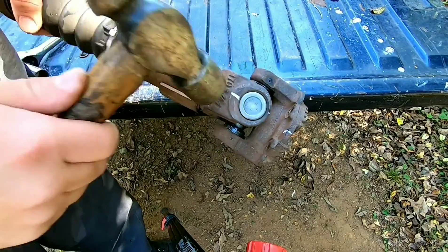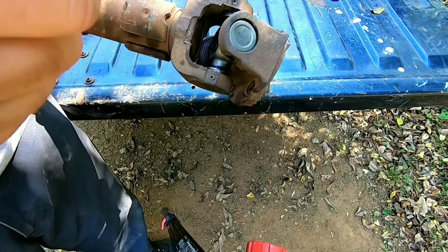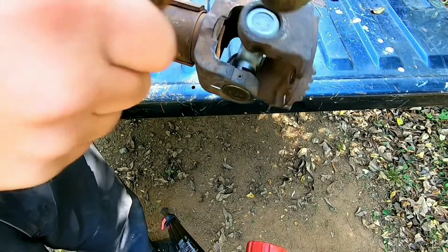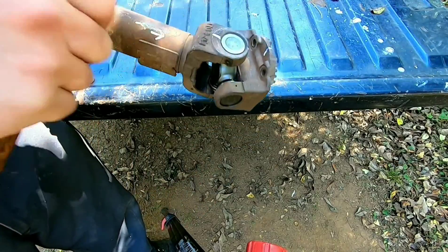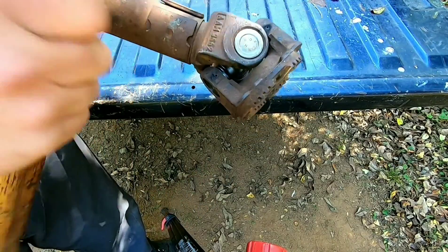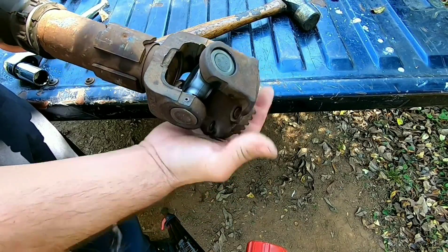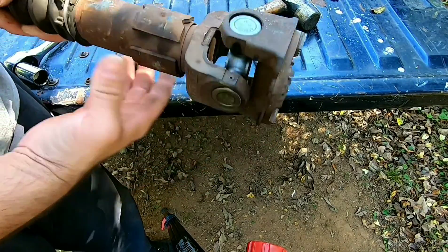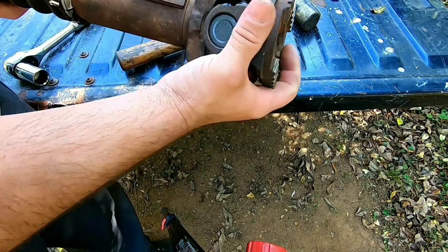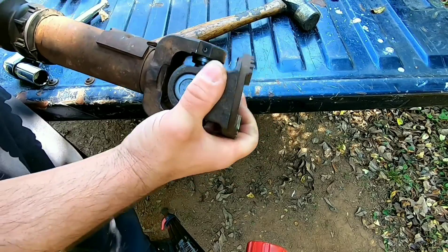You want to take a hammer and just pop it a few times. See, that'll help lift them bearing cap seat so it's not turning rough — could cause premature failure. But it'll loosen up when it gets on there. I like to loosen it up like this so I know everything's working smoothly.